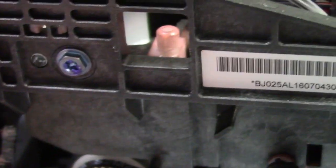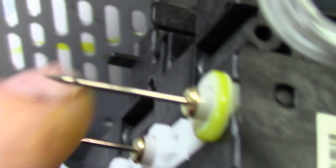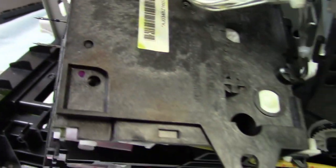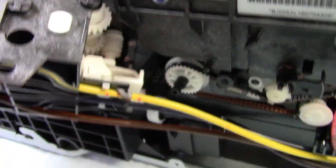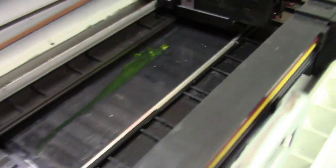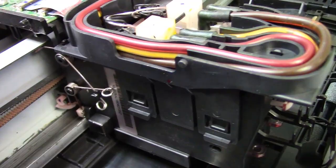It's very unlikely you're going to get a clog in the hose. Most likely, if you're going to get a clog or a problem, it's going to be up here where that little hole is. You can't really get a good shot at it because it's so tiny, but I took this all apart just so you can see. If you try forcing cleaner in there, it's going to be stopped right here. Then this connects to that, and the bottom — you can see I disconnected it — it follows along and goes to the printhead. You can flush the printhead, but you can't flush it from the cartridge side.